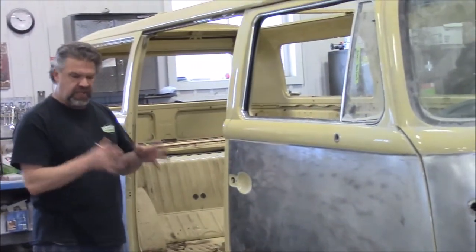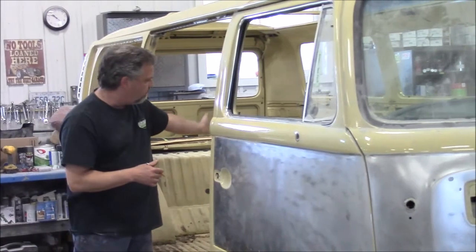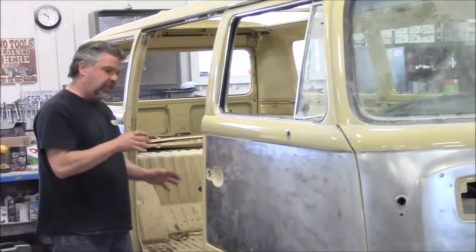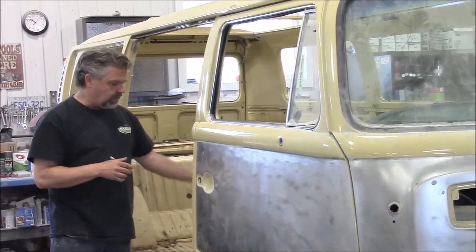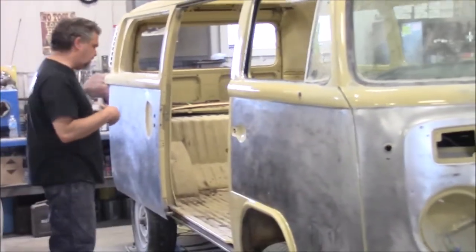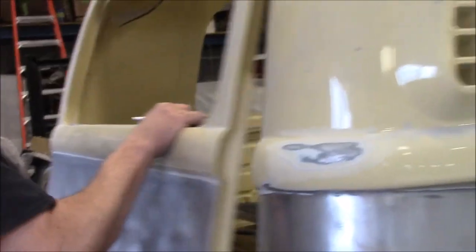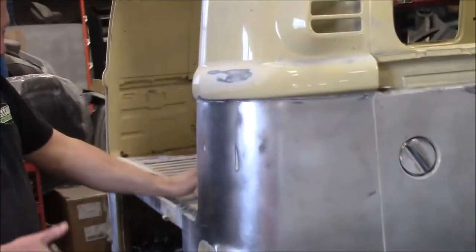The areas that sandblasting will not hurt — the ribbed floor, the wheel wells, that rear section between the fuel tank and the passenger compartment — we'll sandblast all of that, including the spare tire area. The other areas that are more delicate, we'll do by hand using air tools, sandpaper, and little discs, because we want to get rid of all the rust and original paint and lacquer primers to see if there are any rusted-out areas. As the camera comes this way, we're going down the passenger side to the back section. We've ordered some replacement panels for this bus.